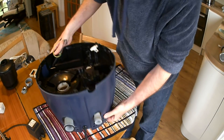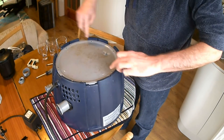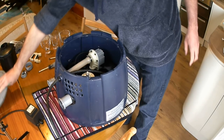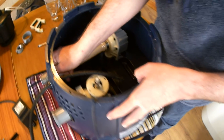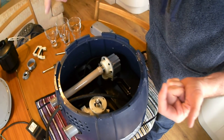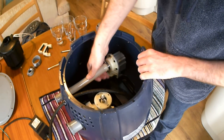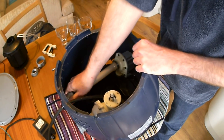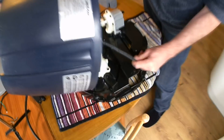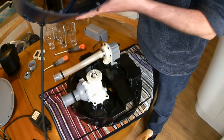Next thing you need to do is flip the unit upside down. I have already done this while the camera was off. Remove four screws in this base plate here — that will come off, bringing the earth lead with it. Put that to one side. Now is the difficult part: you don't have to do this, you can maybe work in there, but you can take out this whole unit now from here. A bit of a pain to get those through there, but they will come out with a jiggle, wiggle, and poke, and you can liberate the whole thing.